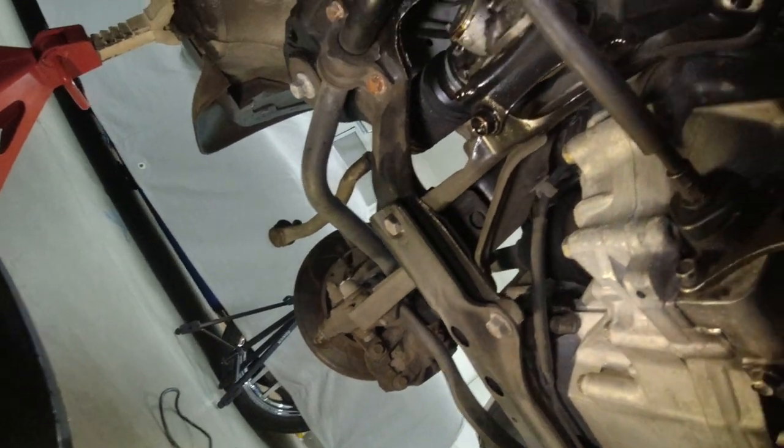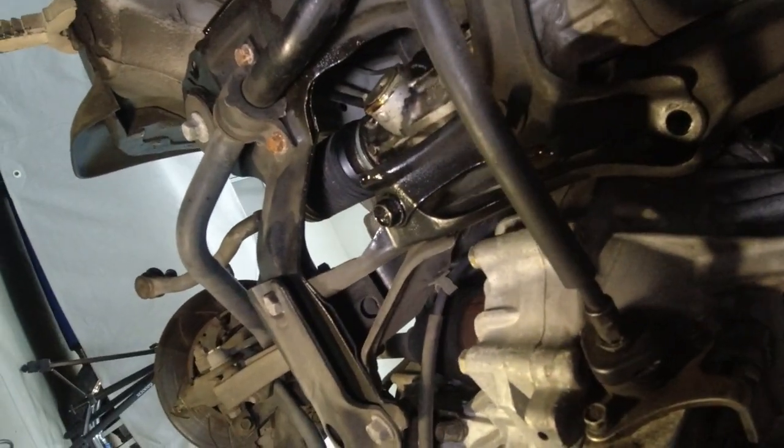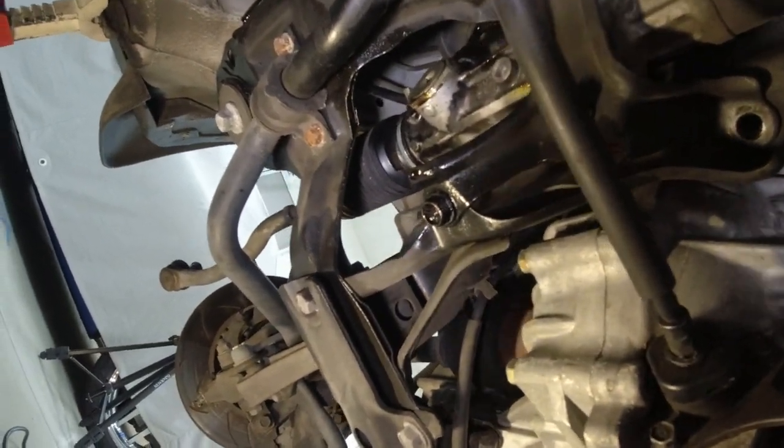I think I've seen on Honda Accords where these bolts for that rubber cushion are on top and you have to go lay on top of the engine to reach them, and you got to reach way down. Kind of nice they put the bolts on the bottom on this car. So let's work on the stiffener brackets underneath now. Under the car, we're catching the drip, drip, drip from the gearbox on the power steering.